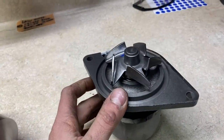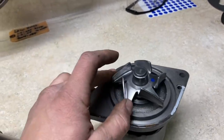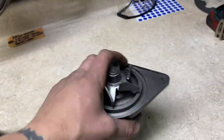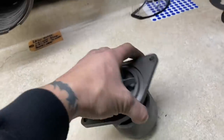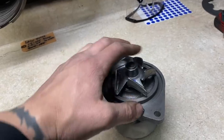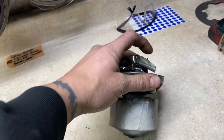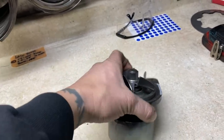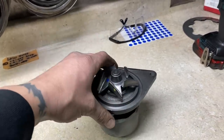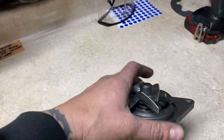You can see there are a total of five fins, and there are many different ways to do this. I've seen guys just grind two of them down, I've seen guys grind all of them down. In my mind, since this is a spinning shaft, I take them off evenly - as even as possible - using a flap wheel. The more of the fin you take off, the less coolant will circulate, so I wouldn't recommend this for a tow truck, but for something you're going to hot rod at high RPM, go ahead and clip it.